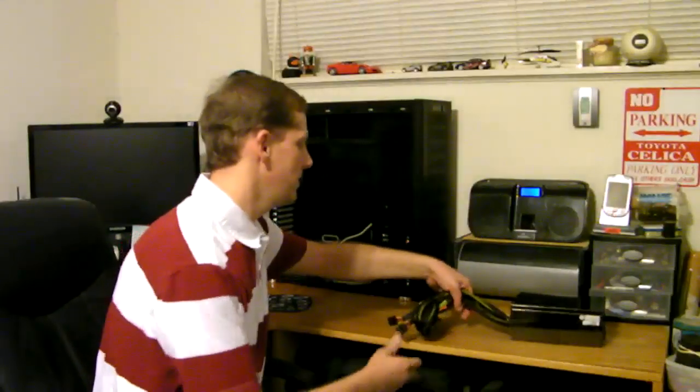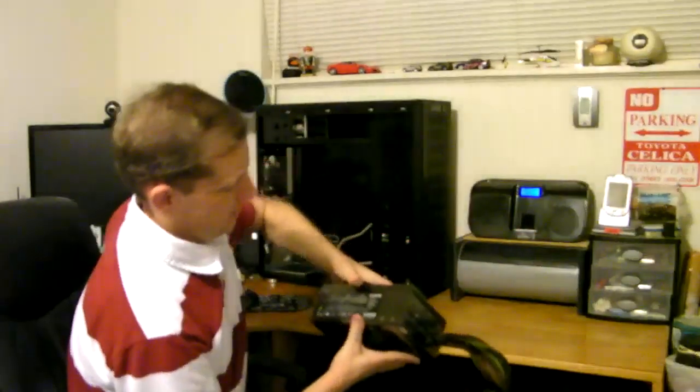It's 80 Plus certified. This is actually an 86% efficient power supply, so it's very good. It's 850 watts. It is modular in design. It has heat pipe cooling inside. All the cables are sleeved, and it has a nice smoked chrome finish on it, so it's really nice looking. And it has a 135 or 140 millimeter fan, so it's a nice big fan. It should cool well and not make any noise at all. And so it should be a really good power supply.